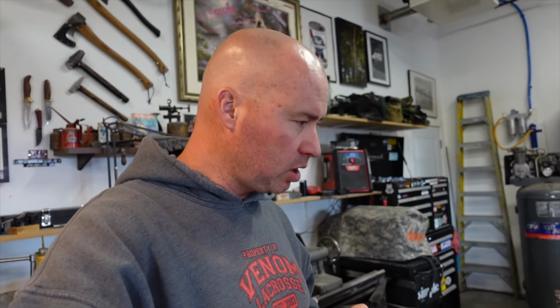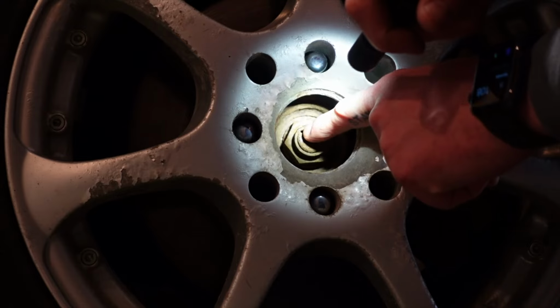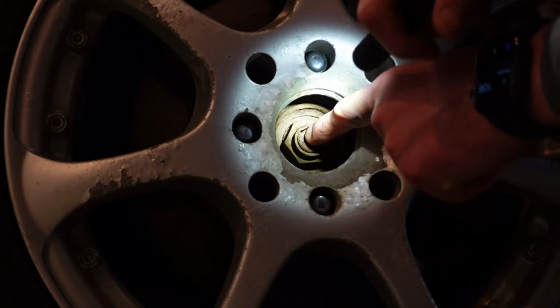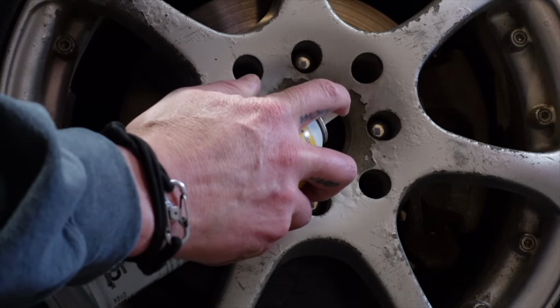So it's currently 1:06 p.m. I'm going to see how long this takes, and then we can get an equivalent. We're also going to call a shop to see how much they'd charge for this, so I'll know how much I saved and what I'm paying myself per hour. On this axle nut, once you install it, you hit it with a hammer and a punch to lock it down onto that key so it doesn't come loose. Get a little liquid wrench on there.